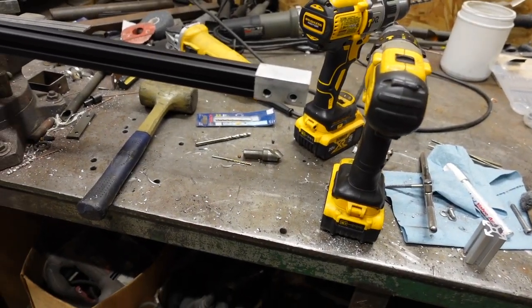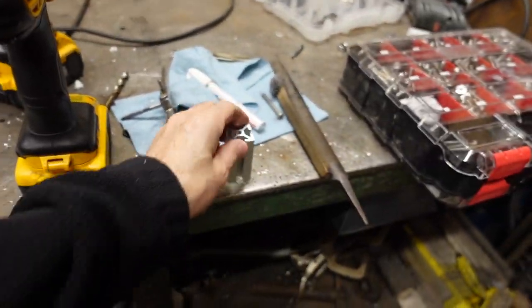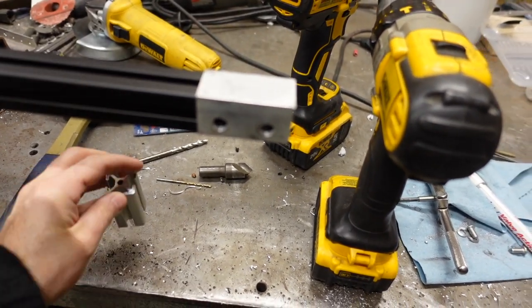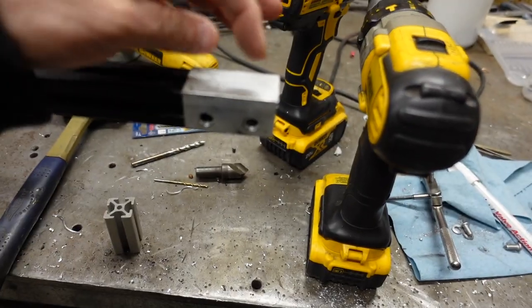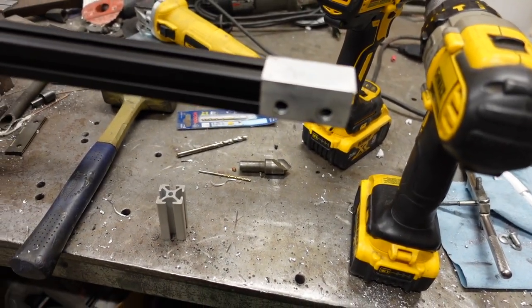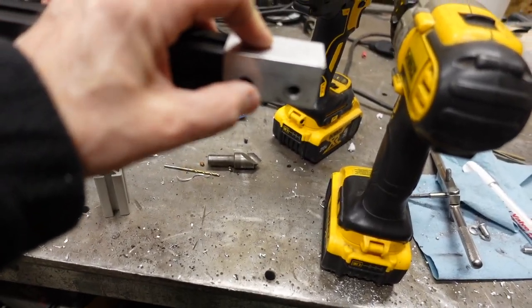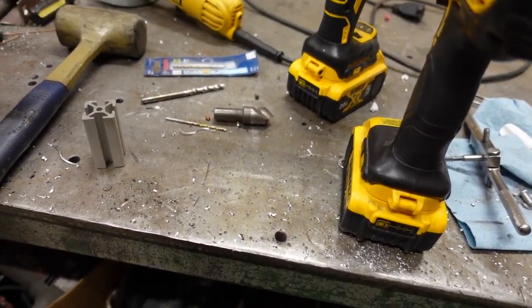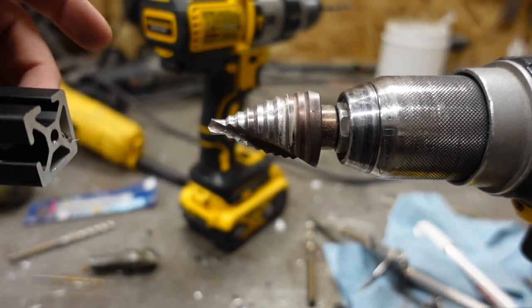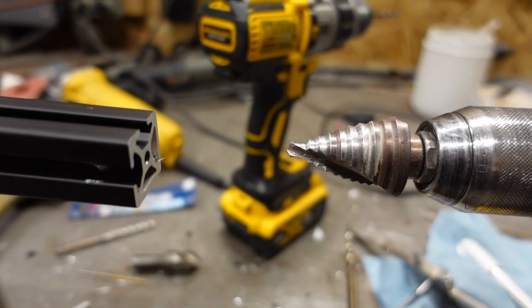To center the hole I use a jig that I've made — this lines up perfectly. For the crossbar I've made it so we can do two holes for the one-by-two, or just use the first one if you're going to do a 10-series one-by-one. Then you can drill the hole right where it should be. We use a step bit here, which we've seen before, to drill in and countersink the flat cap screw.